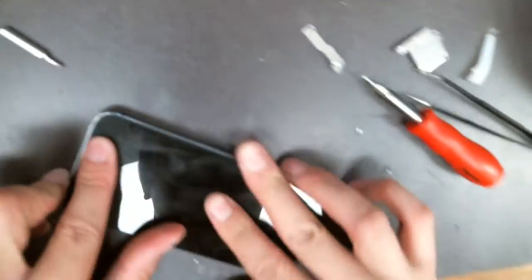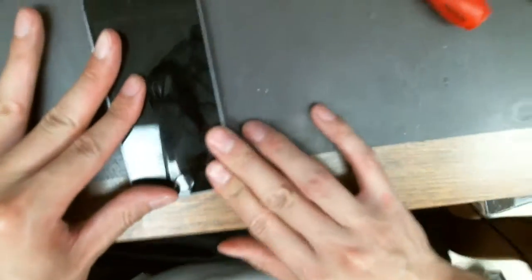I'm going to make sure the touch is good because I moved that screen a little bit when I put it in. You want to make sure the screen is aligned properly before it's closed and make sure the connectors are closed. Very important — don't play with the FPC connector too much, especially when the battery is plugged in. Even if the phone is off, that's still a danger — if the phone is on it's even worse. Alright, I'm pretty convinced this time it's good so I'm closing it. Turning it on — I'm not going to wait, I'll just screw the button and put this in.